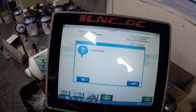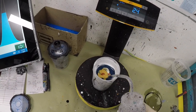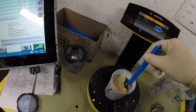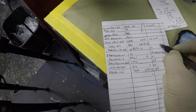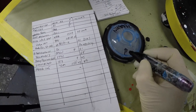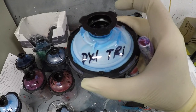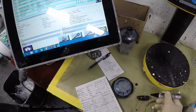Now we're gonna add a reducer. If it's a solid you reduce it by 10%, if it's a metallic or pearl you reduce it by 20%. This one calls for 10%, which is gonna be 26 parts. On the reducer you don't have to be exactly accurate — you can be a little over or a little under as long as it's added. Mix it up nice and good. Every car I write down my paint code and the variant — which was a darker X1 — and then I do the same on the cap so if I need more color, or if the detailer needs touch-up paint, he knows where to find it. I label all my paint with the date so I know how to find it. This is the tri-coat mid coat for the Honda Civic, so we're gonna add more paint here. Always, always label your cups.